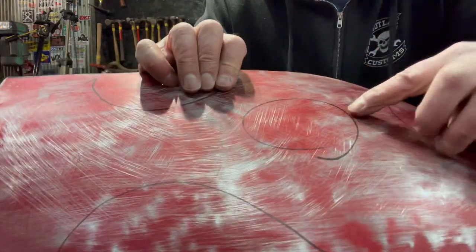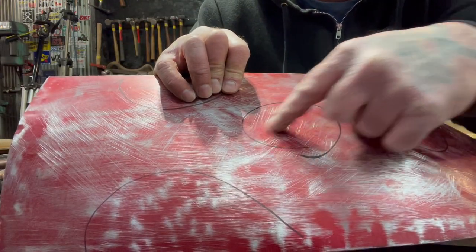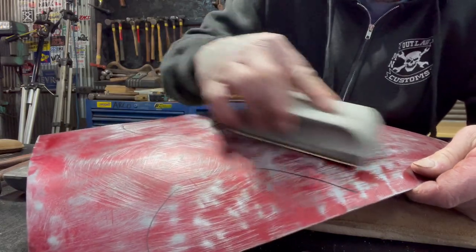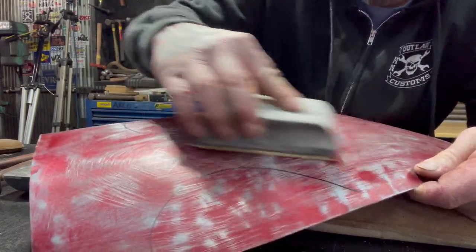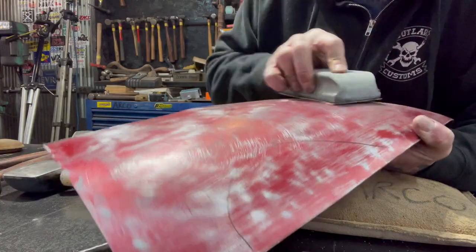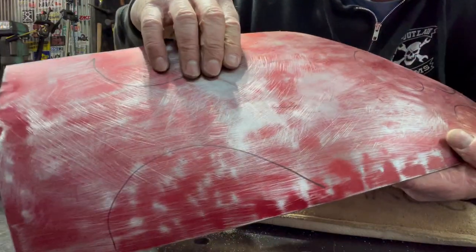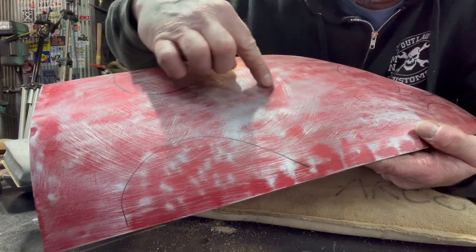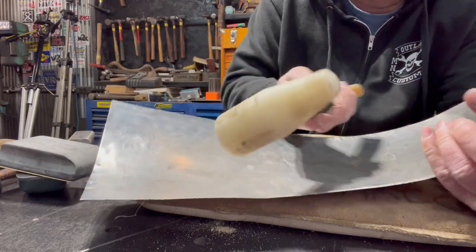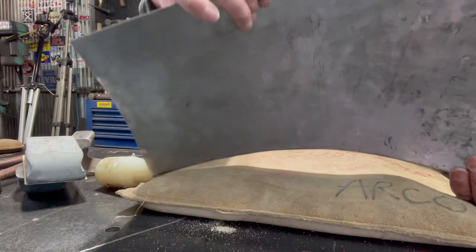Now I'll check out that spot — you can see the red right there, and I can tell that's a low spot, so I want to go ahead and hit this with the sandpaper and see where I'm at. Most of it came out, except you can see this line right here, so that's what I'm going to work on next. Light taps, and you want to use the wide part of your hammer. If you use the thin or smaller part, it's going to leave dimples in there really bad. Right now all I'm trying to do is raise that panel.